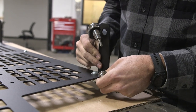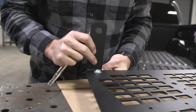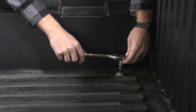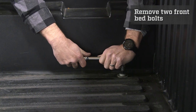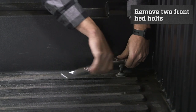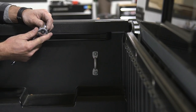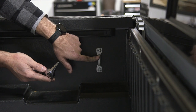The bolt is tight however I'm still able to adjust the mount. Now we're going to grab our T55 Torx and loosen and remove our two front bed bolts. It's very important when loosening your bed bolts to ensure that your socket is all the way down in the bolt and apply downward pressure, as these Torx heads can strip if the tooling is not straight. Next we're going to grab our T40 Torx and remove just one of the tie down hooks — it does not matter if it's the passenger side or driver side.